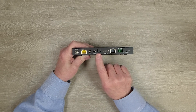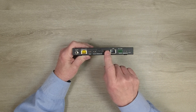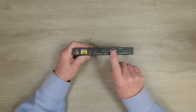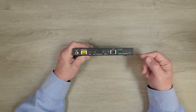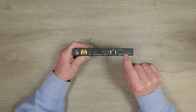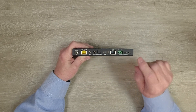The HDMI input port connects to whatever media device you'd like to share content from at the remote location. The LAN port can be connected to your router, which then extends that 100BaseT LAN out to the remote location. To the right of that is an RS-232 connection port — this unit can share RS-232 connections across that same LAN, and you can use the included connection block to make wiring easy. To the right of that is a service port and switch used for pushing new firmware versions to the unit, as explained in the manual.